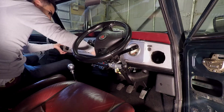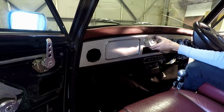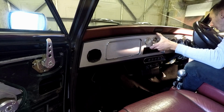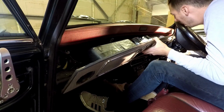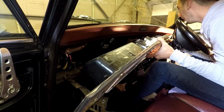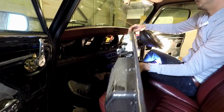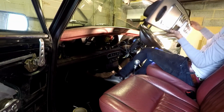The reason for the holdup was a few things still being plugged in at the back. The speedo cable on my car is very short, and it must be undone by reaching through the stereo space. Angling the dash forward, I can see the final connection holding me up. It's this round one on the back of the rev counter. With that off, the dash comes out, ready to be stored safely, while the rest of the work goes on.